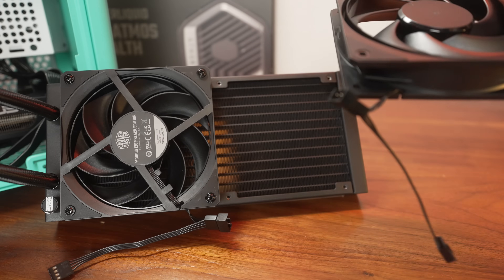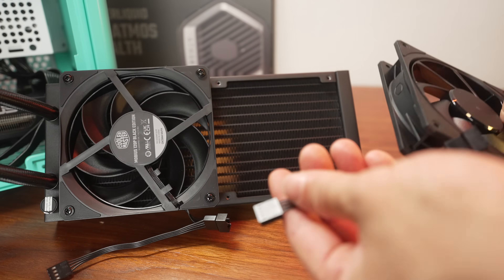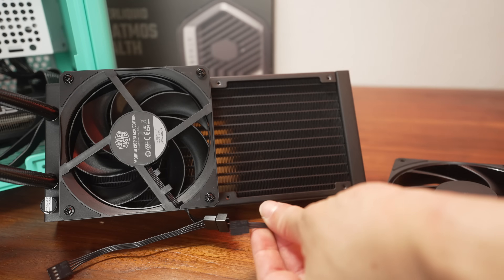The G2s do not go as fast as some competing fans if you want high or very high RPMs. Generally my recommendation is that if you cannot get the performance you need with your 120mm fans below, say, 2,000 RPM or so, it's more radiators or a bigger radiator that you need. But for some builds you are constrained to only one or two fans and need that higher speed — the higher RPM fan — and you will not get that option here, so that's something to be aware of.